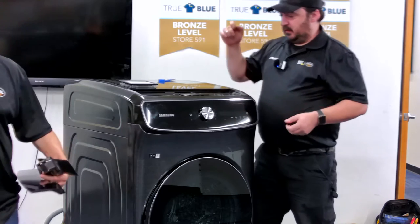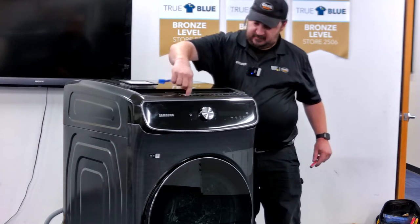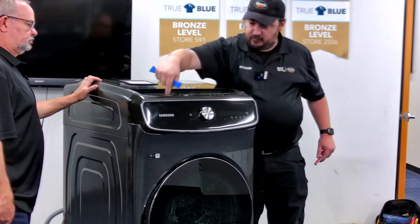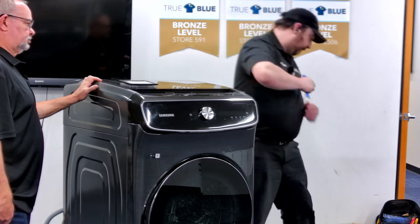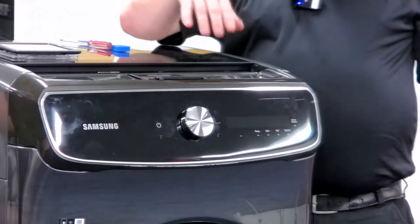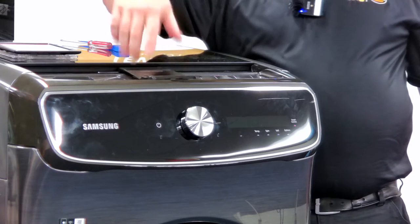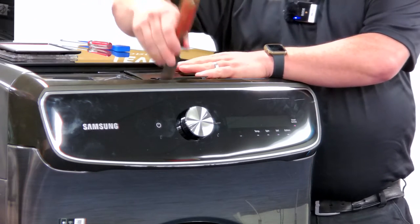You can see this seam that goes across the front. On the original washer, this is all one piece — you get underneath the front edge between the control panel and this piece and gently pry it up. On this newer one they made it in three pieces; you have to take the center one off first because it overlaps the two outer sides. You do it the same way — just get the putty knife in at a pretty steep angle underneath the front.